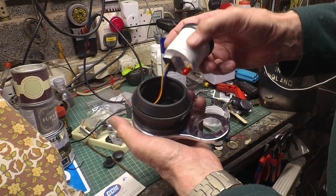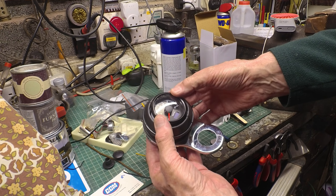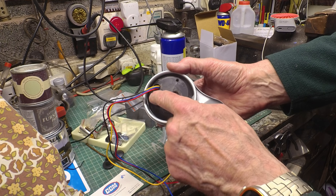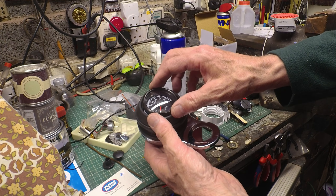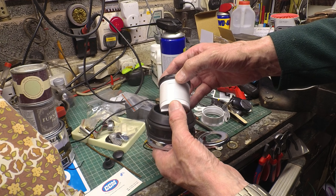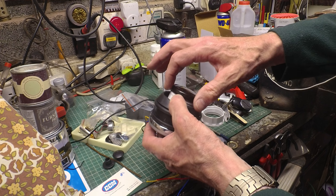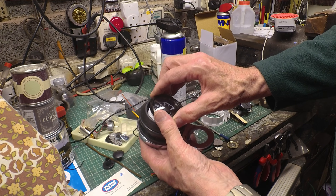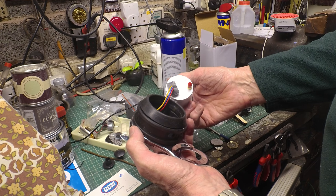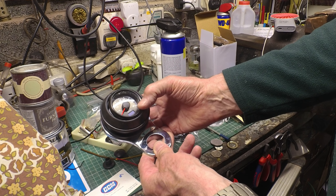This looks too small, but I think with a bit of jiggery-pokery I can fit it into this original cup — or at least original-style cup — and get these wires in. It won't look too bad if it fits in there, and it's not wildly smaller than the original 2.5 inch. A few issues: one is that it's too long, so I'll need to cut out part of the rubber cup and have it poking through. And it is indeed too small in diameter. But if I 3D print a little adapter that fits into the groove on the original cup and also onto this bezel on the new speedo, then I should be able to make a pretty neat job of it fitting in there — maybe paint the backside black — and mount it on the bike so it'll look reasonably authentic and more period than a digital display.